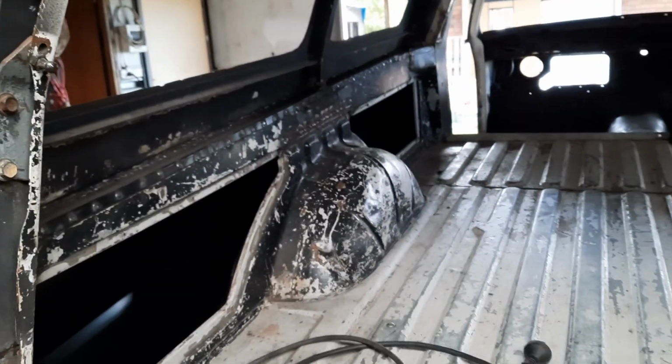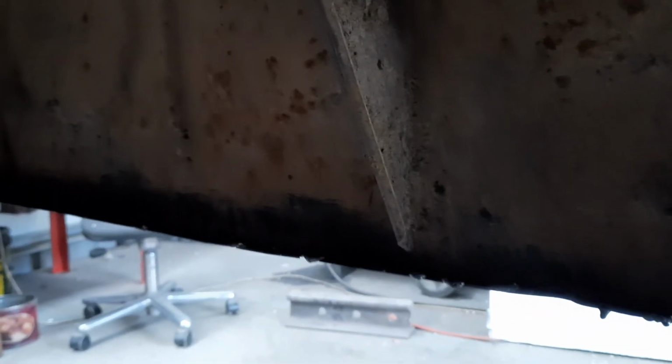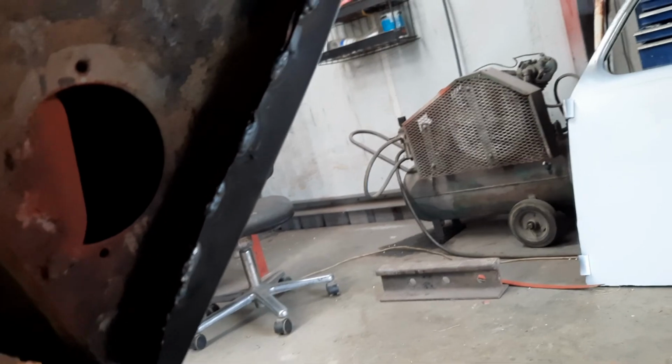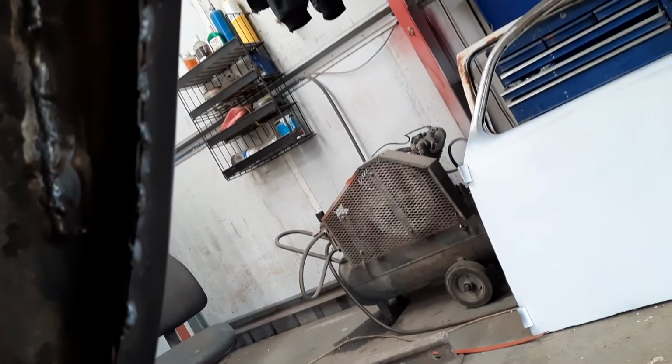Okay, so I'd already finished that before, I think, under there. So, since getting it off the chassis, I welded right along the bottom here. I plug welded this because there was already drill holes in it from where I drilled out the previous spot welds on here. I didn't want to drill a whole lot of holes and do plug welds, so as you can see, I've just done a section of runs every inch all the way up. I've got to trim some of it off.